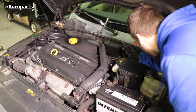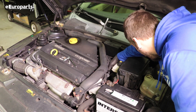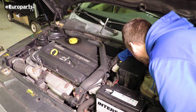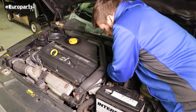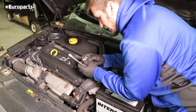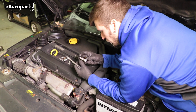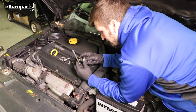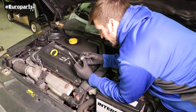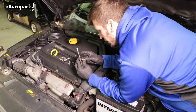To finish it off, the thermostat is going to be well and truly stuck in there. So use a screwdriver and just sort of jam it in to leverage it out. Here we are. This is an old-looking Motorrad unit. You can't really tell if a thermostat is bad just by looking at it, so we're just going to go ahead and replace it anyway.